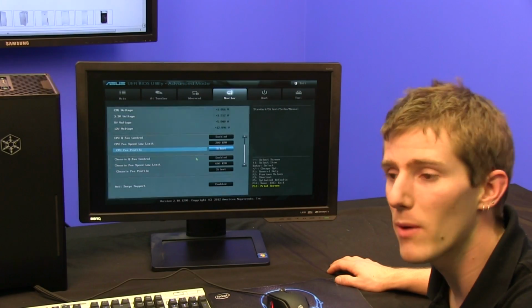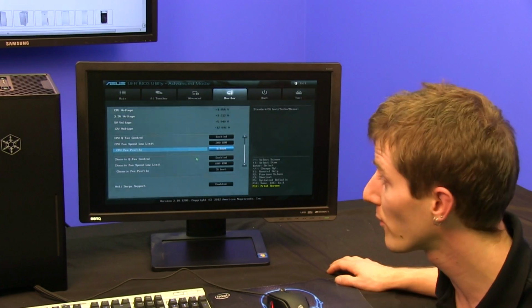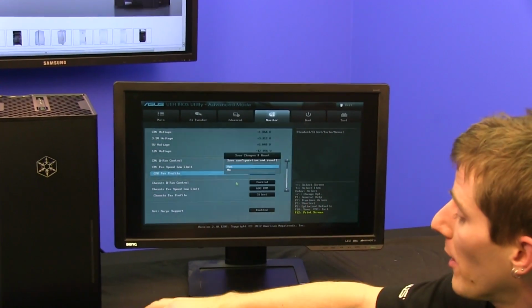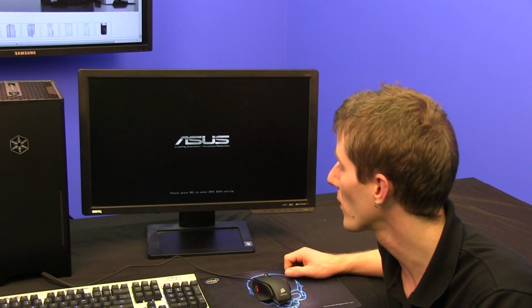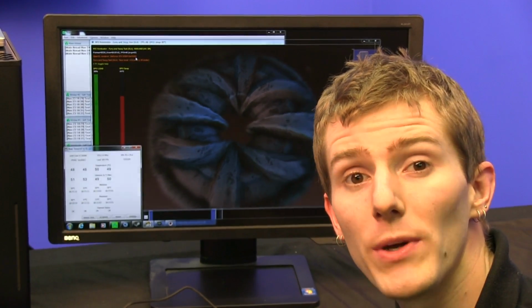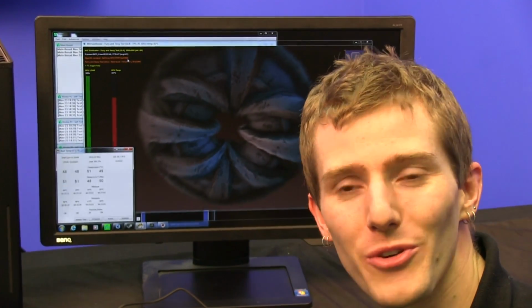And the one last step I want to show you guys to make it truly small, silent, and high performance is the step to change the fan profiles to silent in the BIOS. We're not doing any overclocking in this particular build guide, although we could once we check out our CPU temperatures and make sure everything's okay, because this motherboard is fully capable of overclocking that unlocked K-series CPU. Idle temps were around 30 degrees on the CPU and 33 degrees on the GPU.